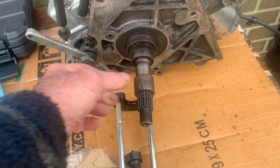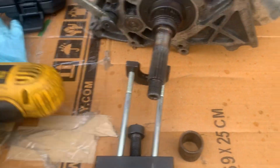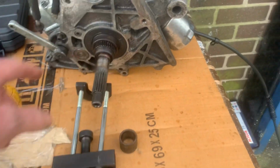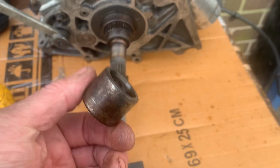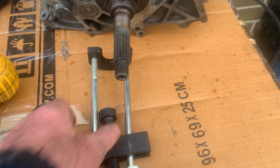But we're going to put a proper heavy-duty twin roller bearing on here, or in the primary that is, which has got 2 seals in, and it's also a double row rather than this stupid system here where you've got a sleeve and then the rollers actually run on this sleeve.